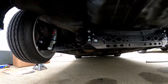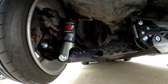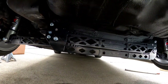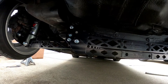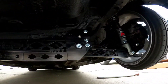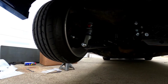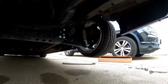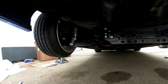Alright guys, it's all set up. Drop lower control arms with Downstar hardware, subframe brace, lower tie bar — I'm going to get Downstar hardware for the tie bar too, but that'll do for now. Same setup on the other side. I only adjusted the coilovers a little bit so far — I'm gonna drop the car and see where it's at and then adjust some more. I also decided to paint everything over here all black. But yeah, that's it — there's the finished product.